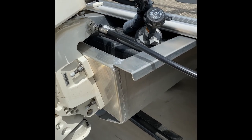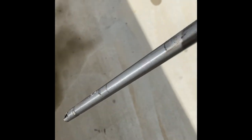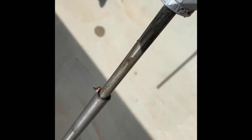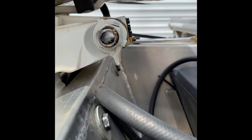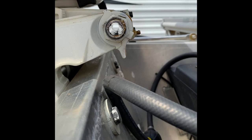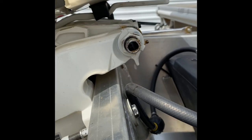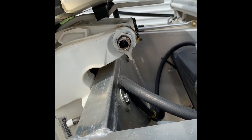I got the steering cable out and it has water dripping off of it. You can see it — water sitting inside on top of the grease, kind of bubbled up. So maybe that's part of the problem with the steering. Maybe it wasn't sealed up well and just has water inside there.